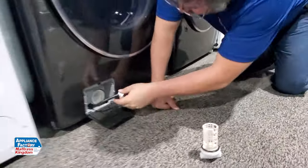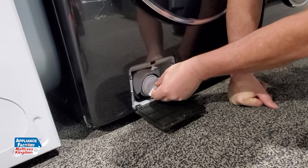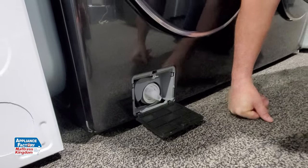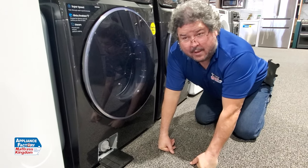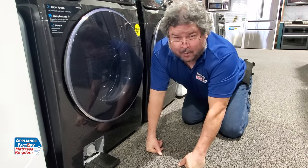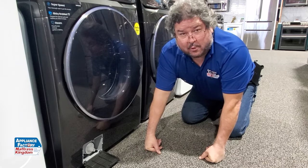Now, when you're putting it back together again, it's really important to make sure you get this in right and tight. When it goes in, start screwing, and you want to go until it stops. This one actually has a little click, like your gas cap — clap, clap, clap — that tells you it's already done. If you don't tighten it up, it will leak and you'll have a lot of issues. But you can also over-tighten it, and it won't leak, but you won't be able to get it out. So you want it good and snug, and keep an eye on it the first time you wash, just to make sure you don't have a leak.